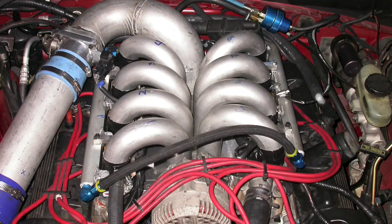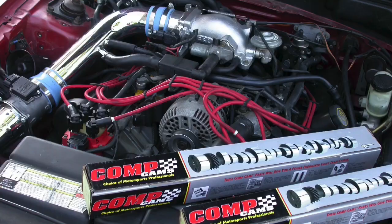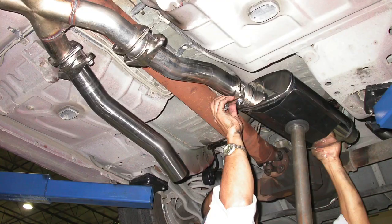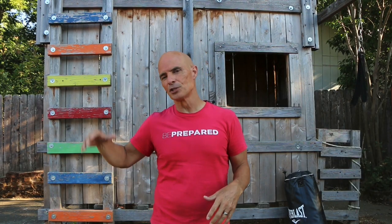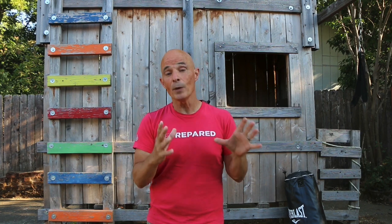But I didn't do that. I decided not only was I going to make 300 at the tire with all non-PI stuff, it also had to be drivable because this was my daily driver. So I set pretty high goals, and this required me to make my own custom intake. I tried everything — different cams, different short block, long tube headers, different exhausts, different throttle bodies, pulleys, even ran nitrous. All we could get to was about 280 horsepower at the tire. We tried ported non-PI heads, everything, and it just wasn't going to get there. The problem was a bad intake manifold, and there weren't a lot of aftermarket intakes available for the non-PI stuff.